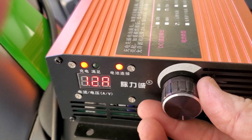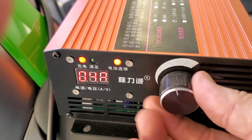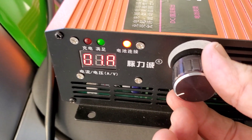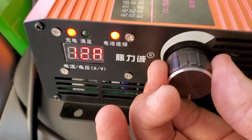But pretty neat — you can adjust the current too. That's full charge at 12 amperes, 11, 9, 8, 7. You can go ahead and slow charge it. This is good for trickle charging. It'll shut off because these are really nice chargers that come with these bikes.